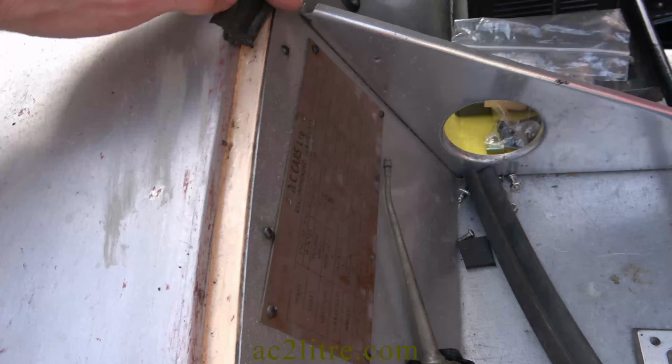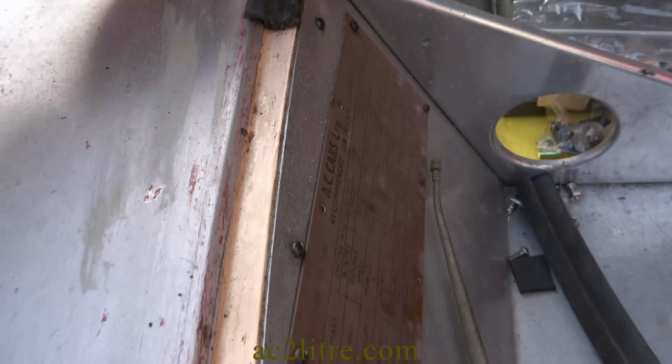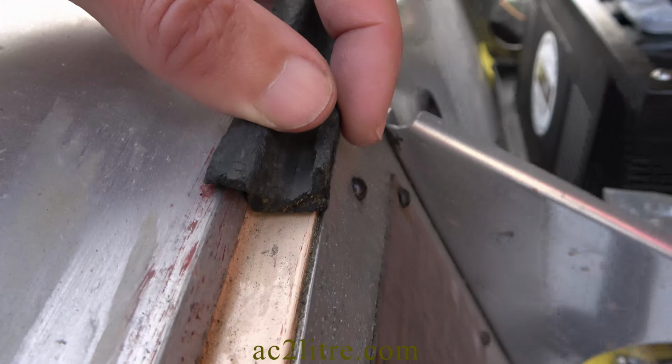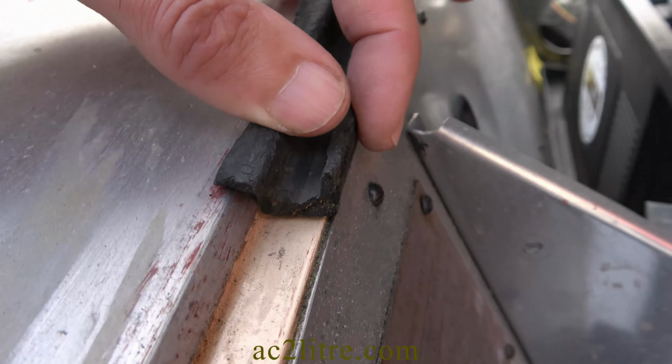Coming very soon will be various rubber seals, mainly for windows on the saloons. I have also commissioned a batch of bonnet rubbers. These seem to be unique to AC saloons, and the only remake of them was 40 years ago by the club. Unfortunately, those were made to the wrong dimensions. They need to keep the rear of the bonnet flush with the scuttle. This is part of my 1949 original seal compared to the 1984 remake.